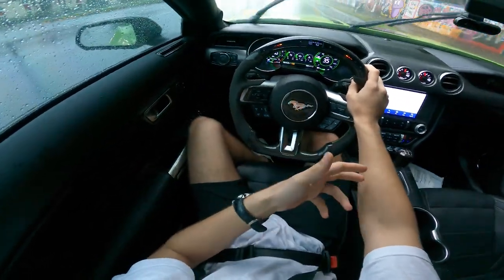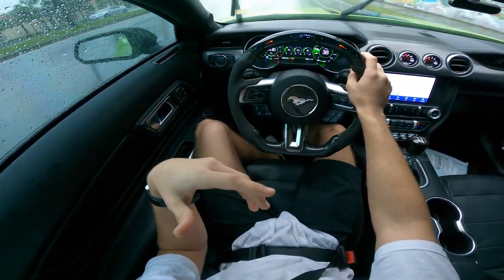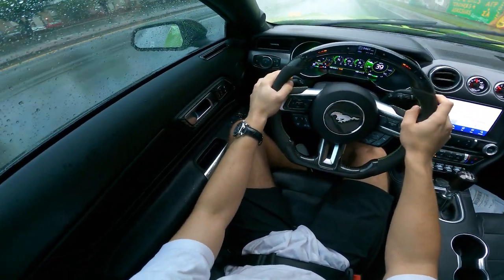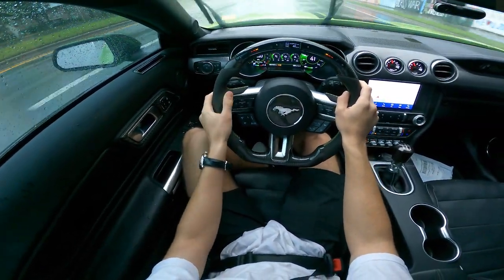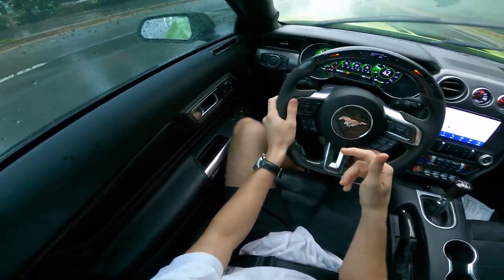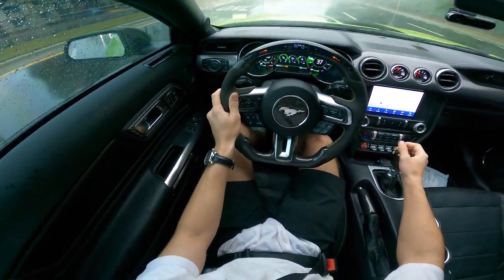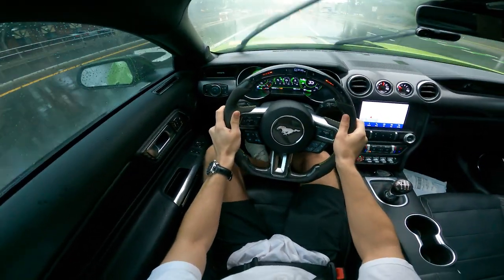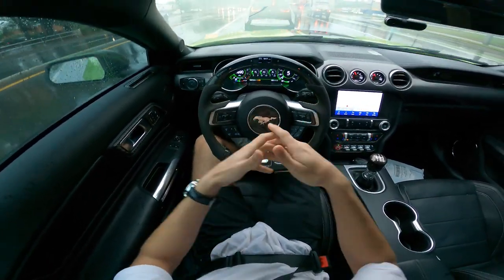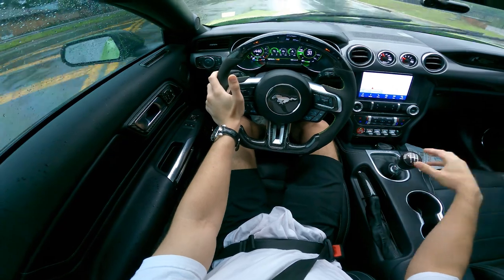You guys get the idea — it's all about matching your transmission speed, your engine speed, and the road speed into the desired gear. Going about 40 miles an hour, if I want to go into second gear I'd probably need about 4000 RPMs or a little bit more in the throttle blip. That was perfect right there — we needed around 3300 RPMs. You just need to match the speed that you're going at in the desired gear.